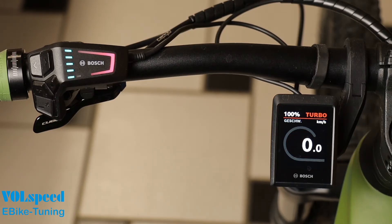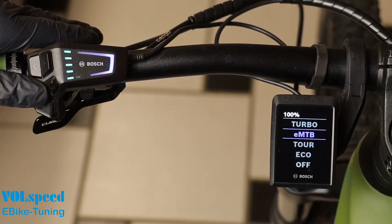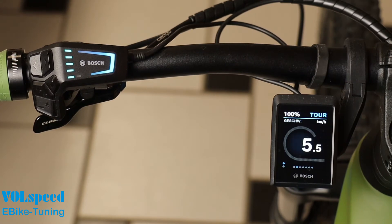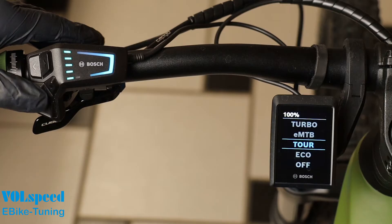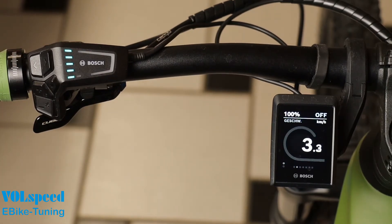The so-called dynamic mode allows the motor to slow down more gently when the set limit is reached. You activate this mode with the sequence minus, minus, plus, plus, minus, minus. If the display then shows 11 kilometers per hour or 6.8 miles per hour, the mode is switched on. At 10 kilometers per hour or 6.2 miles per hour it is switched off. The setting is saved.